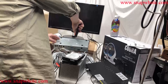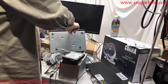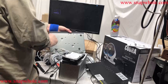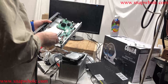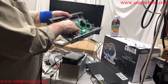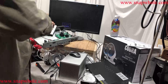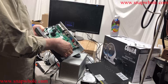You need to be at least a little careful because when you take that fourth screw out, if you don't watch, the hard drive will drop out and it could damage it. Once I get those screws out I just pull that back. They've put the SATA port right there on the bottom of the motherboard, which is okay — most systems do something like that. I've got a four terabyte I want to try, so I'll lay that in there, scoot it right up to that port, and push it in.